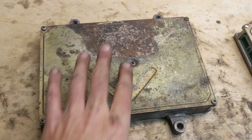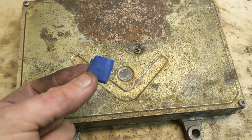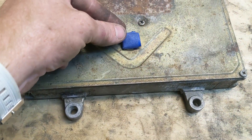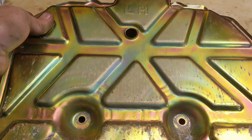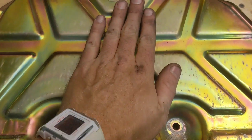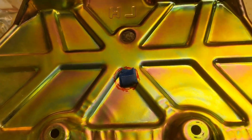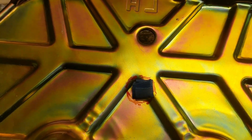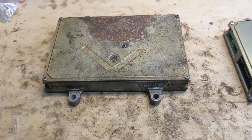Moving forward with the idea that I'm going to drill a hole in my kick panel to align the new ECU cell light, I was trying to figure out a way to do it. So I took a piece of double-sided painter's tape that I wrapped up and laid it very loosely on top of where that new LED light is. Then I'm taking my kick panel and laying it down over top, aligning the four holes. Once it's aligned, I'm pressing it down and then pulling it off quickly, hoping that tape sticks. That way I know exactly where to make my hole — I've drawn a red circle around it. I'll drill a new hole in this position and hopefully when I lay that back on top, I'll get my cell light lined up with the new position for the new ECU.